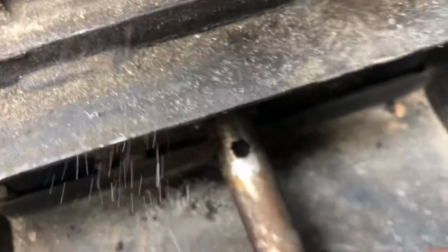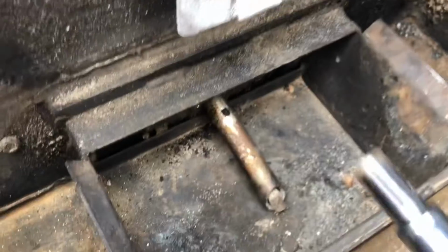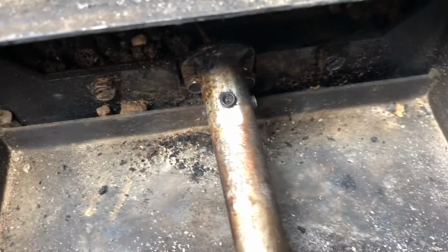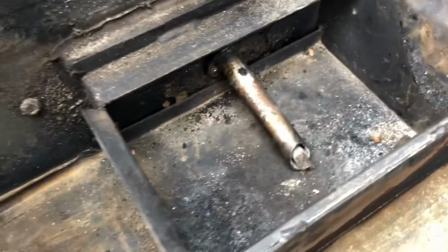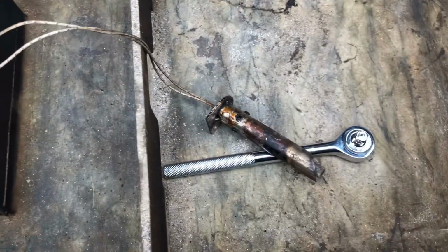Now, if y'all can see down there, there's two tiny little screws underneath it, okay? And I've already kind of loosened them on mine, but they're 5/16 screws, all right? So you're going to need your socket with an extension, but you've got to get those screws out. You can see that one down there to the left. First order of business to removing the old igniter, down there, and pull the lighter out, or the igniter out. See, with all the cord and everything.